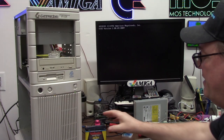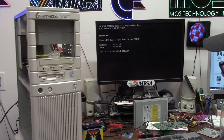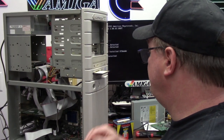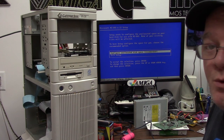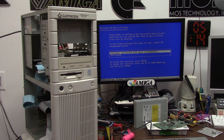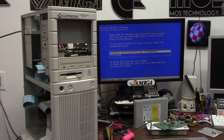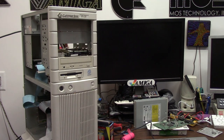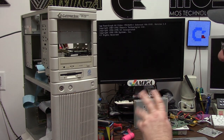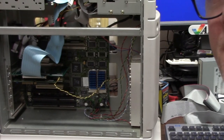After ten floppy disks for MS-DOS, I also have eight Windows 3.11 — or Windows for Workgroups as people call it — disks to go through. I had major hard drive problems. A couple hours later, I had a slice of pizza and I'm feeling better. I put in an Adaptec 2940 SCSI card — you can see that blue ribbon cable — and a 500-something meg SCSI disk. We're going through the MS-DOS configuration, allocating hard drive space. The boot is faster now; I tightened up the cable management a bit too.